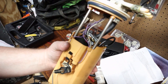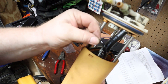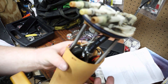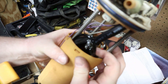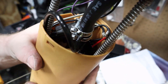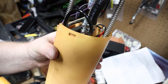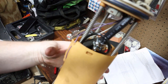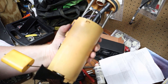Okay, I skipped ahead a little bit but basically this is the finished product. If you've got a Venturi pump and you have to reattach this Venturi line, it is going to suck. I went through maybe five attempts to get this reconnected well — it's got to be on there well enough that it's really attached to that Venturi fitting. Getting the end of the tube the right temperature — just hot enough that it will go on and not so hot that it crumbles — was a huge pain, but it's in there now.